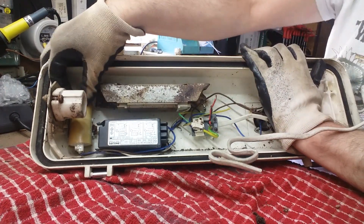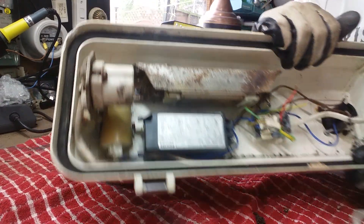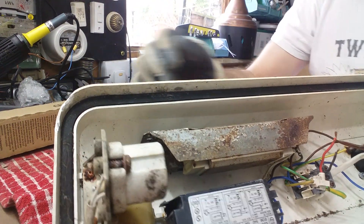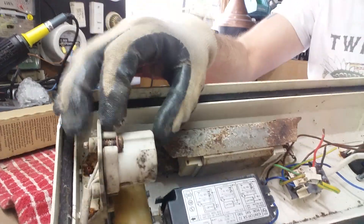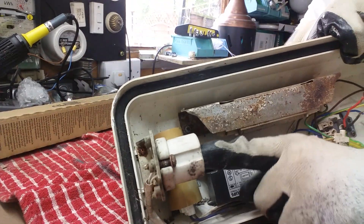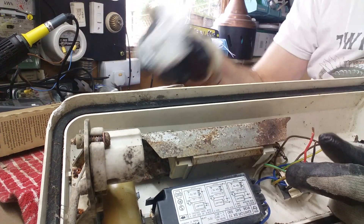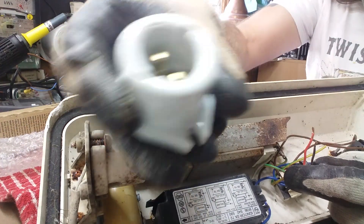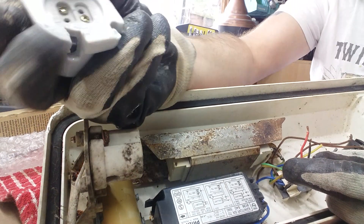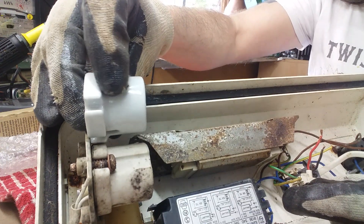This capacitor is probably useless by now — very burnt, heaty, and crispy. When I do a refurb I change the lamp holder because they have trouble with the springs — the little terminals inside tend to fail. So what I do is just get a nice new lamp holder like this — brand new. These are about a quid each with a few pounds postage. They are literally the same thing and will go in there very nicely indeed.